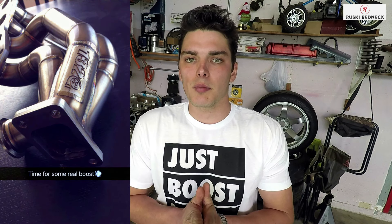You could literally buy everything you need to turbo your car for around $2,000 to $3,000. There are a lot of sweet deals on Facebook, Craigslist, and OfferUp — go on the groups like Boosted K-Series Buy Sell and Trade. Keep in mind this is online, you can get scammed or sold broken parts, but at the same time you could get really good rewards. Any K-series manifolds — the flanges fit — and for the most part you can make any sidewinder fit the TSX with a little fabrication on the wastegate location.